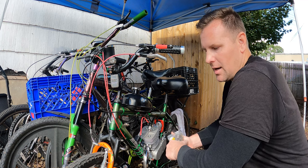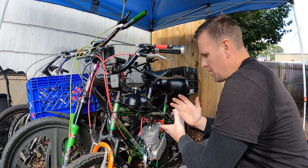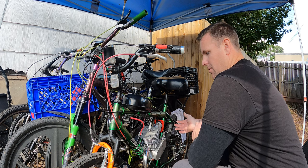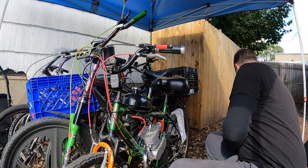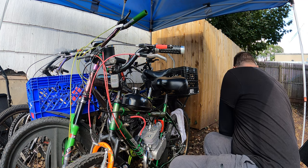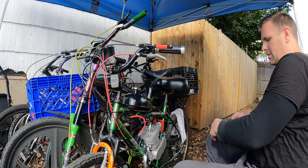I'm doing a lot of thinking. I want to say I want to start with the carburetor, but no matter what, when it's all said and done, it's not going to backfire out of the carburetor because it's bad carburation. When it starts backfiring like that, before it even starts running, while you're trying to get it to start up, that's usually timing. And that's what we're gonna try to get into. So I think we're gonna start with the timing.